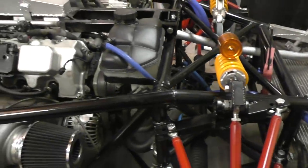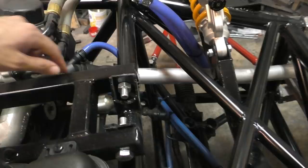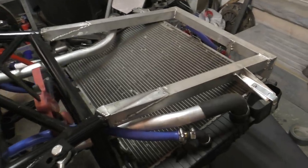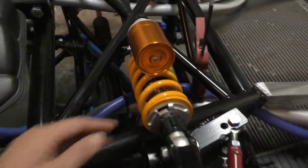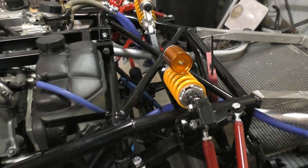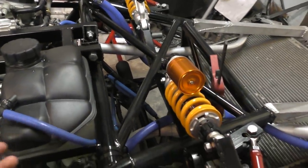While working on the cooling system, I also put the power steering system and the engine oil cooler together. The coolant reservoir is connected with the bleed line at the highest point of the system and a line at the bottom connected to the radiator. The main two aluminum lines flow coolant to the radiator and back to the block. I haven't clamped some lines yet because I ran out of clamps, but I'm buying more. For securing hoses I've used wire ties — it's quick, easy, and way easier than making brackets when you need to make repairs.